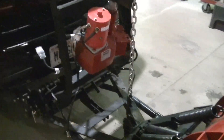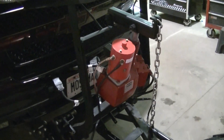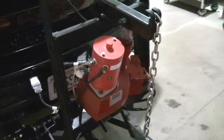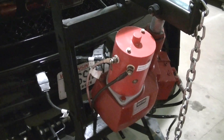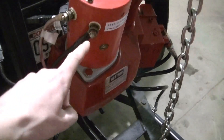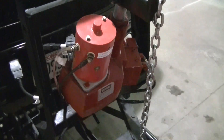When I went to test the plow to get it to stop squeaking, five minutes into that the plow was barely lifting. Doing some checking, the motor was getting really warm, and so was the positive cable. I went and got a new motor. You can see there that the ground is different — they put it on the right on the motor instead of on the inside on this ear, because apparently people are having trouble with the ground and burning up the motors.